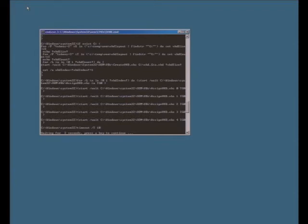Do not interrupt these scripts while they're running. These scripts define your drive letters and iSCSI targets for VRM. Interrupting this process can lead to reduced storage space or non-recording. These scripts may take several minutes to execute. Please be patient. After they successfully executed, the appliance will automatically reboot.